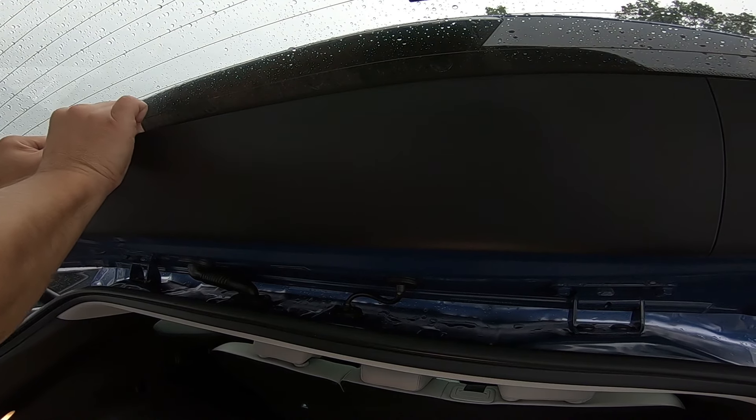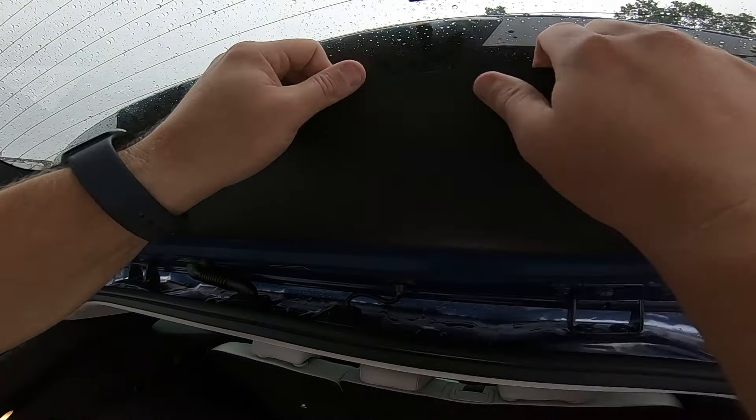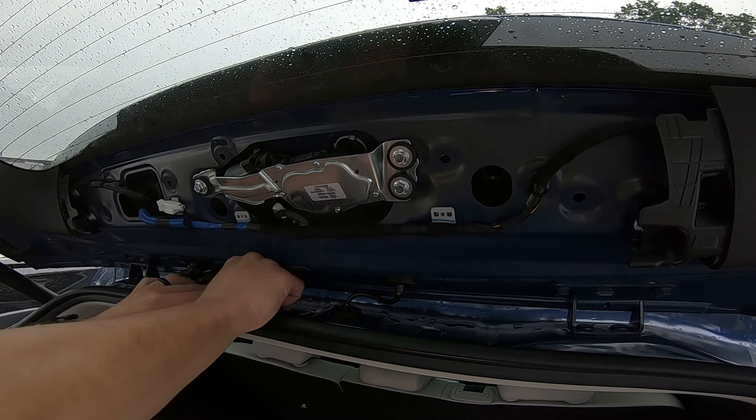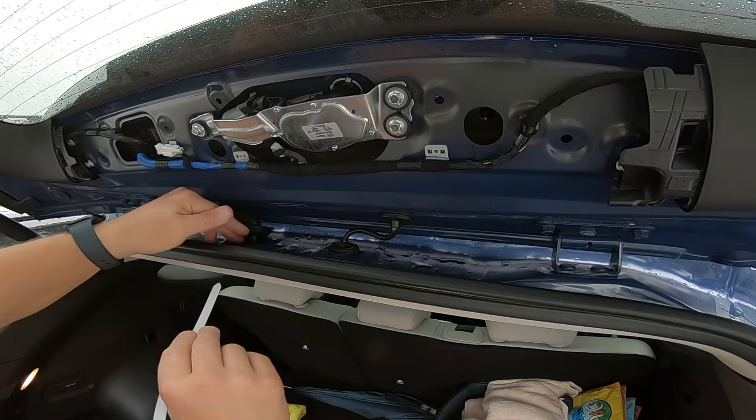The first thing we've got to do is get this panel down. As you can see there's a division here and a division here — most cars you just pull these panels down. Some of them interlock, so make sure you have all of the pieces. Now we've got this rubber grommet here and we're going to use the zip tie method to get a zip tie through it. I've used a whole bunch of things to chase wires, but this super long two or three foot zip tie has been my favorite tool overall.